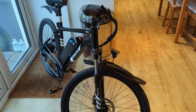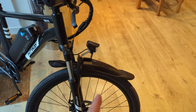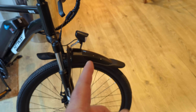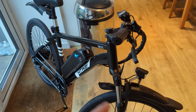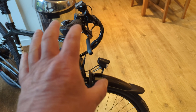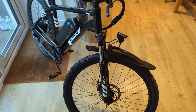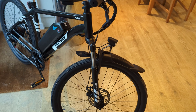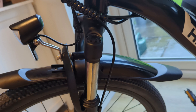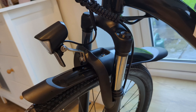I've just done the one-mile test ride and yeah, everything was pretty good. I've got two things to do — that mudguard is clearly on the wrong way around, which is what happens when you don't look at manuals. And the rear brake needs adjusted because it's just not powerful enough, and the brake lever is coming in too far. We'll tweak that. We now have the mudguard on the right way around — it does look a bit better. I don't know why I didn't spot that in the first place, but I hadn't checked the manuals.